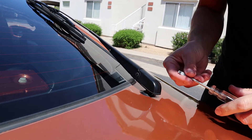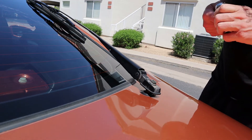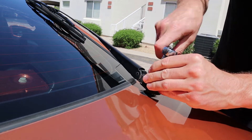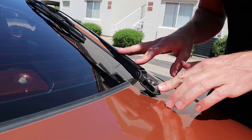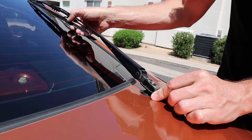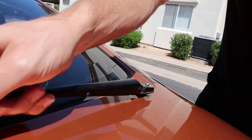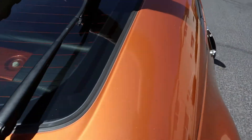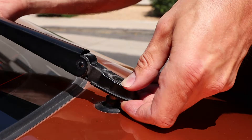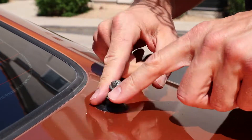First things first we've got to pop off the rear wiper. You just pop off this little cover with a flathead — this bolt is 12 millimeters. Now I've seen people sit here and pry on this, or take hammers and whack it, but all you have to do is thread it off. If it doesn't come straight up just thread the wiper off, keeping your finger between the body and the wiper. Once you've threaded it far enough you just pop it off. I'll put the old bolt back for now — I've got a part coming from Amazon to plug this but it hasn't arrived yet.